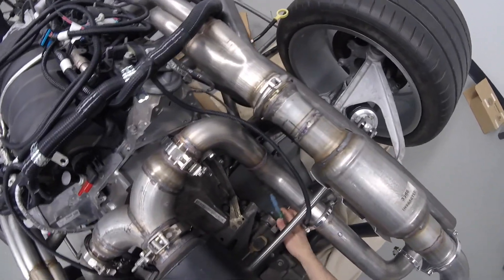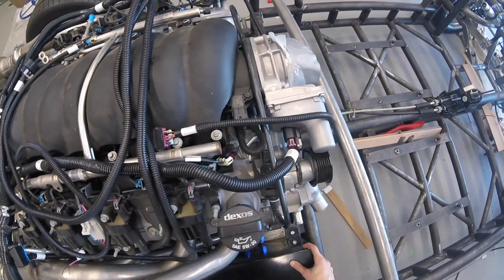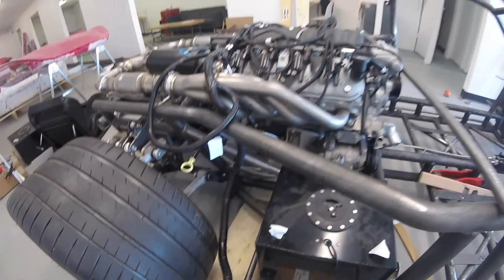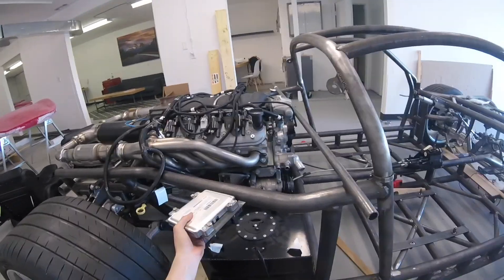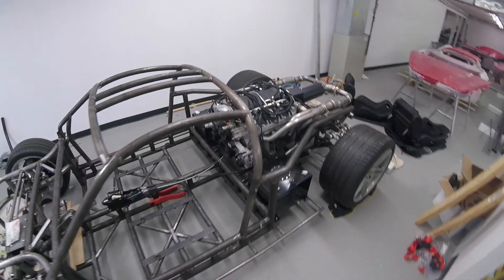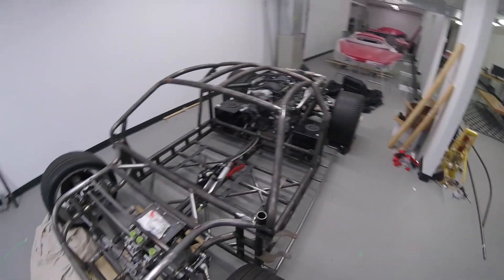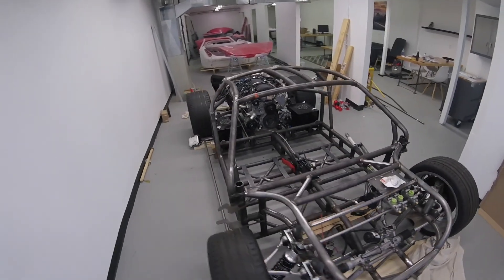The fuel tank is in — there are only three mounts, there's a flat bar strip with an inch offset on the side. I'll figure this one out later. It'll probably go something like that, and then later this evening I'll add the second fuel tank, same as the other side with flat bar. The second fuel tank has been mounted at three points, only lightly tacked. I planned to put them closer together than originally planned, but I'll put some heat shielding between the engine and the tanks — there's still plenty of room.